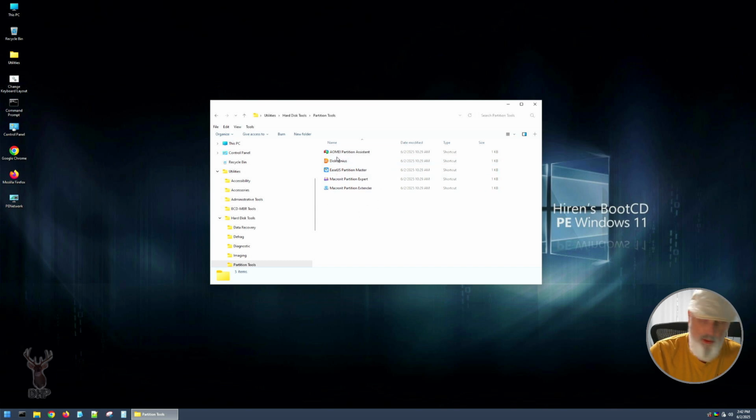Now, normally you can't go from a larger drive to a smaller drive because it won't fit, even if you have a bunch of empty space. So one approach is that you actually take the system and shrink the partitions on the bigger drive, and then clone that over to the smaller drive, and it works that way. And then when you get finished, you just expand the partitions out. Some software will let you copy only what's actually on the drive, so you can set the partitions to the size they want.